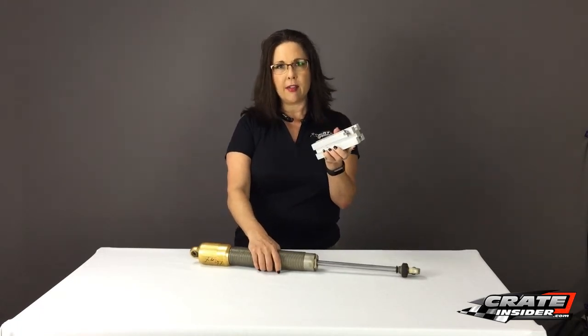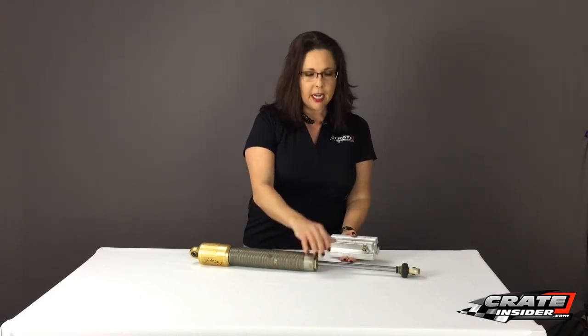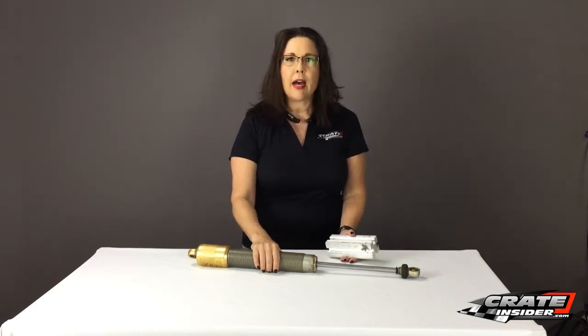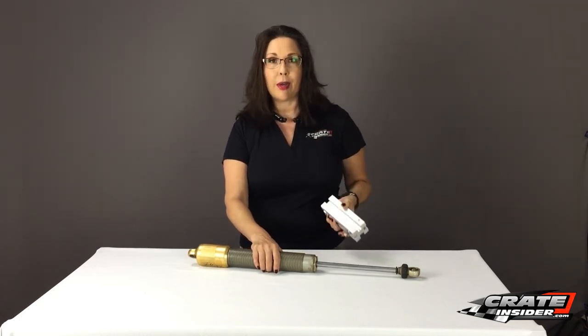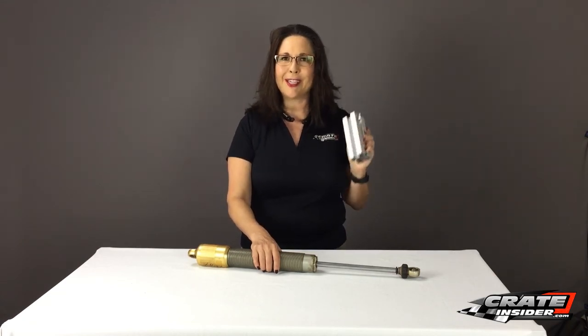It's just a really handy tool to have in your toolbox. It's great to have at the track because even a small bend in a shock shaft is going to make the piston so it's not square to the bore. This way you can ensure that you've got the best product out there that you're racing with. And for $59 it's really a bargain for what you can do with it. That is our shock shaft checker from Hammond Motorsports. Thanks for watching.